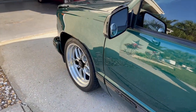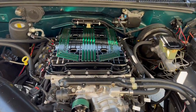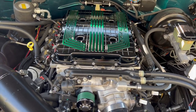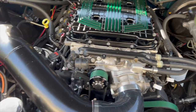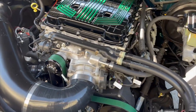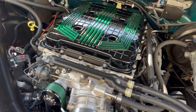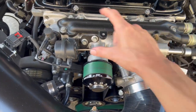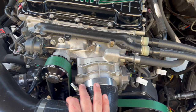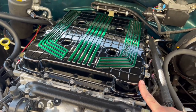Killer Performance did a big build series on this truck from start to finish. As you guys know, it's powered by an LT4 supercharged LT1. The block is an LT1 with stock rods and pistons, with a small cam in it and the LT4 blower. I believe the snout portion is ported, and it has the tall lid for the intercooler. It's on a GripTek 2.5 pulley — a little bit smaller than stock.